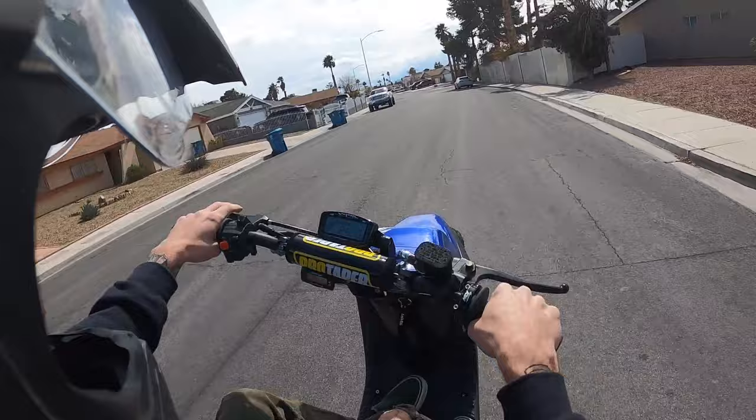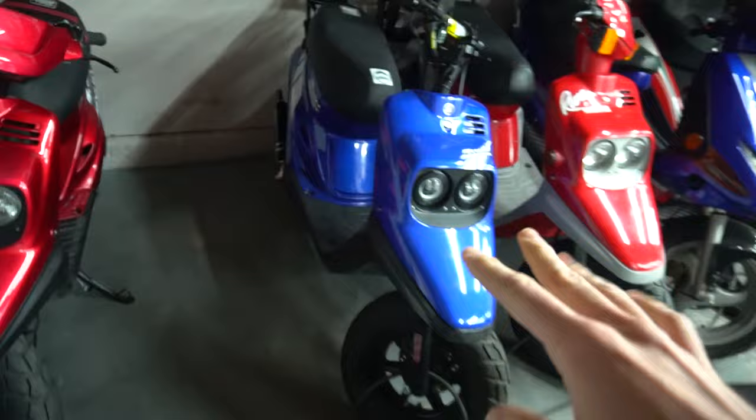Alright, so I just wanted to conclude the video on this Zuma. More than just what I showed in this video, I ended up actually spending way too much time swapping things back and forth this day. I just didn't turn my GoPro on every time because it was starting to become a hassle when I was just doing the smaller changes. But I ended up lightening the rollers a tiny bit. I ended up putting back in the 1500, the yellow spring. I tried a few different ways with the stage 6 rear contra spring. I tried heavier rollers, I tried lighter rollers.